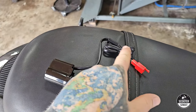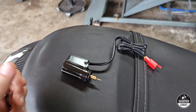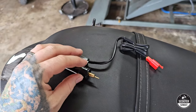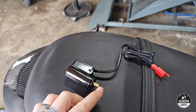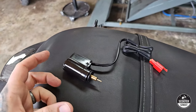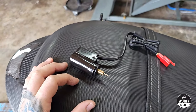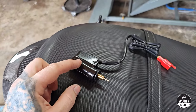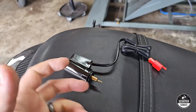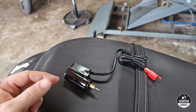In addition to the small thermostat, the auto choke also has a small coil. When you turn your key on to start your engine, the bike supplies power to this choke cable, which heats the choke up. So as soon as you start your bike, the choke is already starting to heat up and close off. This process should take about two minutes of the engine running for the choke to heat up enough to close off the choke fuel gallery.